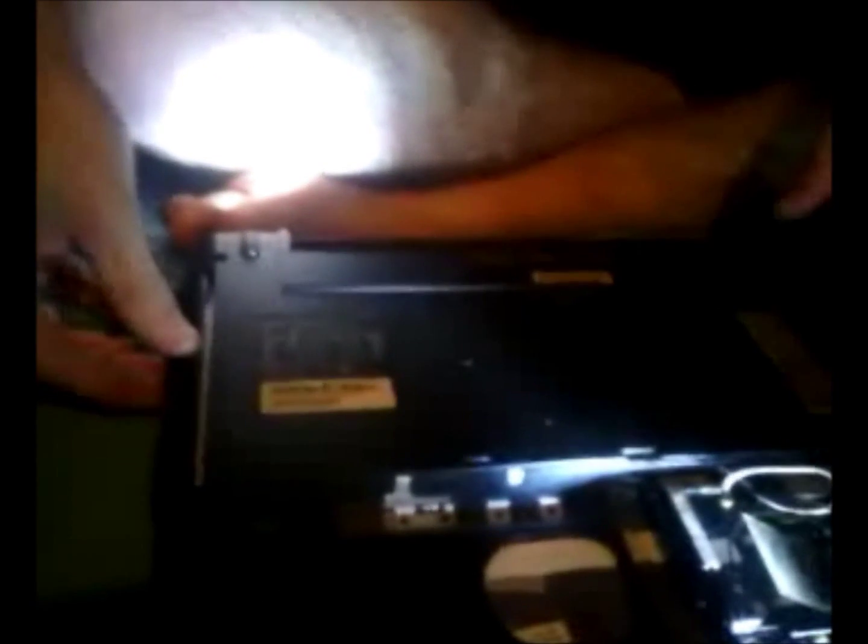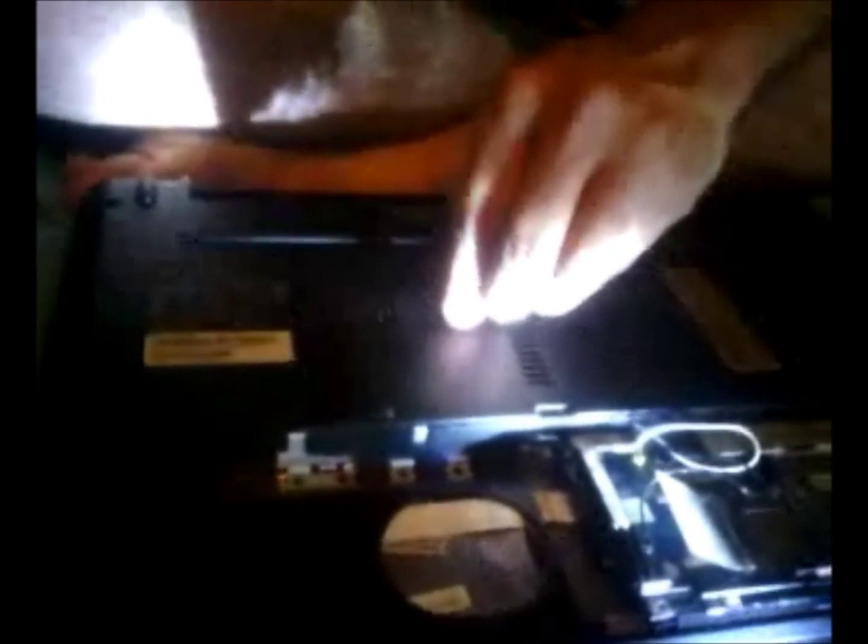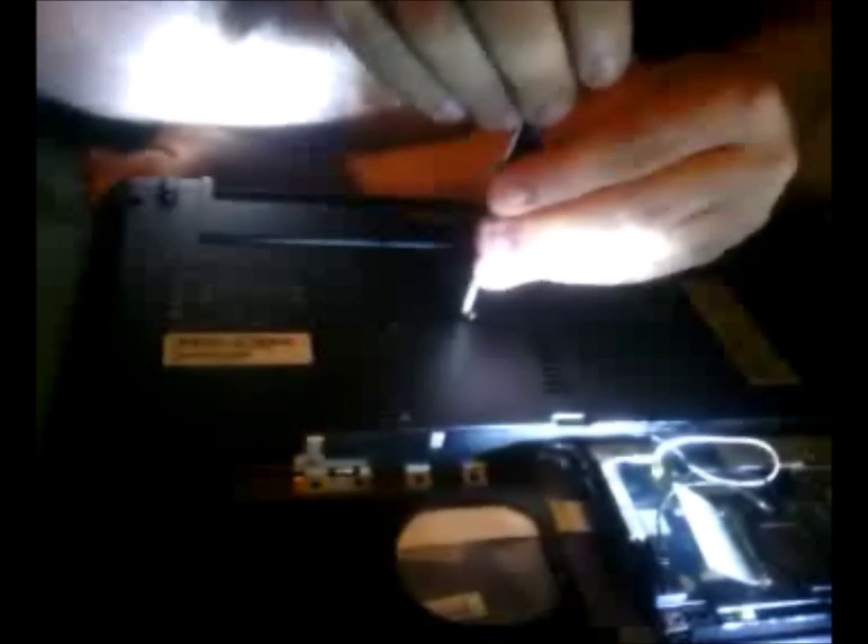Usually the bezel will line up, it'll kind of be ergonomic that way. You can also tell because this part where the screw goes in, it'll be on top. Also this screw here. Alright. Now we're going to put this screw in here and tighten it. Tight, but not too tight. Put the screw in right there, the screw hole right in front of the RAM slots. Make sure it's in there nice and tight. Not too tight. Once again, you can't stress that enough.